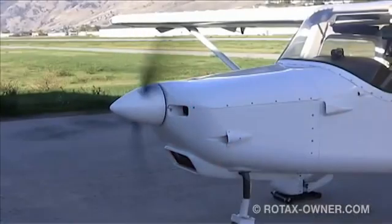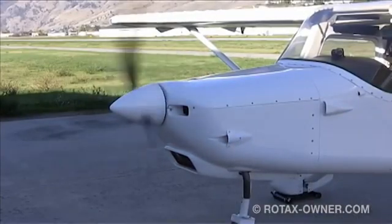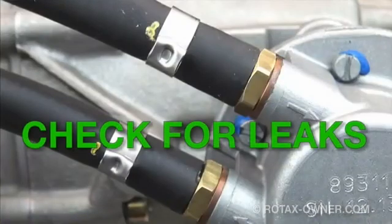These are fairly small values, so using a pressure gauge rated for up to 100 psi will be very difficult to read. Now that you have an appropriate pressure gauge attached, make sure that everything is secure and safe for an engine test run. Start and briefly run the engine, then shut down and thoroughly check for any leakage at our fuel line crimps on the fuel pump. With a leak-free installation confirmed, start and run the engine at various RPMs, verifying that the fuel pressure remains within limits at all RPM ranges. Note that pressure readings will fluctuate at different RPM ranges — pressure will likely drop when coming down from high RPMs, then raise back up when idle RPM is reached. This is perfectly normal.